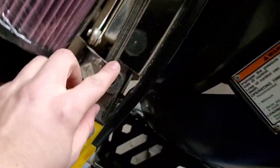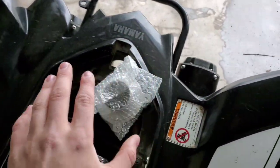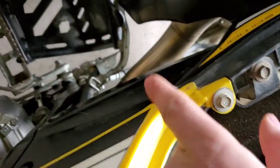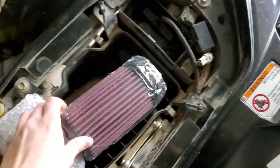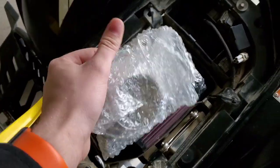I've got to remove the bolts. I've got to cut my custom bolts because these dual exhaust pipes — they sound phenomenal, absolutely awesome — but they rattle every single bolt out of this thing. I lost three just from vibrations, and I've lost my foot peg bolts on both sides from pure vibration. Because of that it's kind of easier since I'm missing four bolts, but also annoying. So we're going to take the air box out, throw the new adapter plate in, and I'll come back with another update.